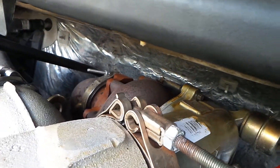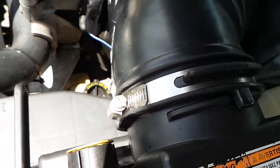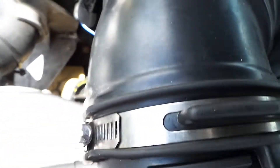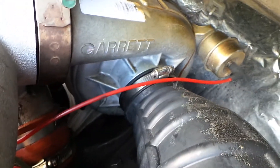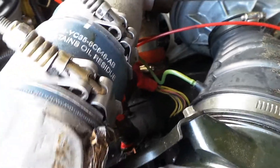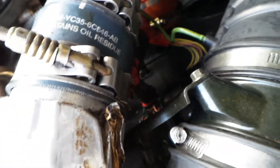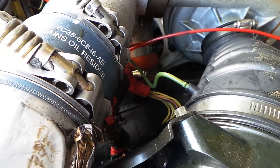If you can reach that one in the back there for the turbo, do that one as well. Then with the flathead screwdriver, tighten up your hoses — the hose brackets, see that right there — and there's a couple right there, one going into the turbo. There's also another hose bracket down by the green area if you look at your truck.